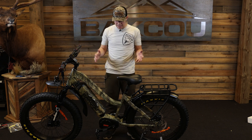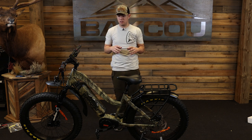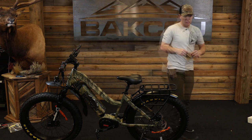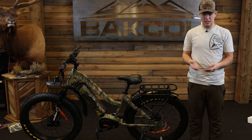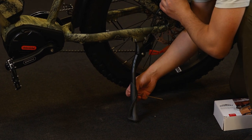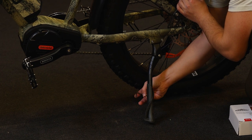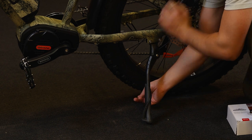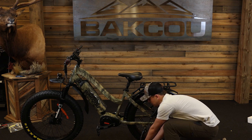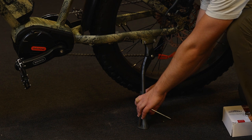One thing I want to talk about: this bike right here is leaning a little bit too much. We're going to adjust the kickstand so it's leaning more towards an upright position, so there's not so much pressure on your kickstand. To adjust the kickstand, use this four millimeter hex key. Get down, put your shoulder on the bike, and lean it to where it is more towards an upright position. It doesn't have to be straight up and down — you want a slight angle, not too aggressive. A good way to tell your kickstand is at a good angle is that your front tire is not moving to the left.